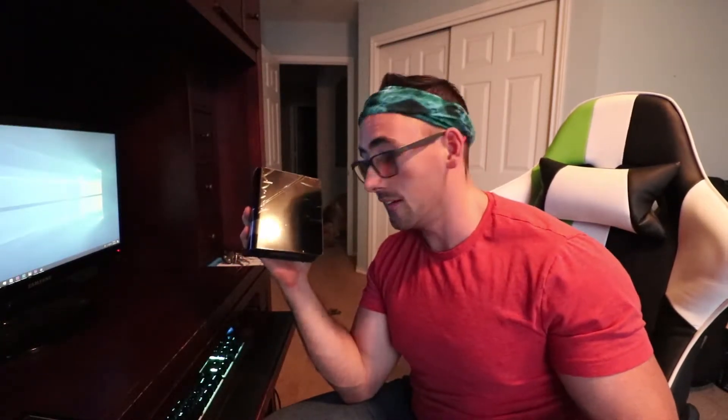We're going to take all of our files from the old drive and put them on the external. If you're like me and you've got thousands of music files, videos, and all kinds of stuff you don't want to lose, what I'm going to do is put all the files on the external first before we do the transfer — because if we don't, there's a chance we might lose everything. All I want to do is put Windows on the solid state and put all my data on the external, then I'll have a free internal hard drive.